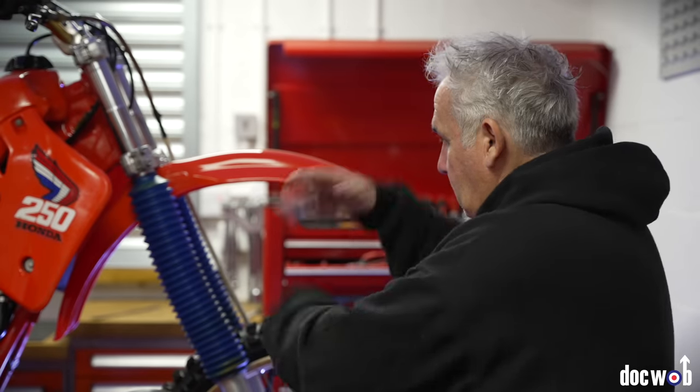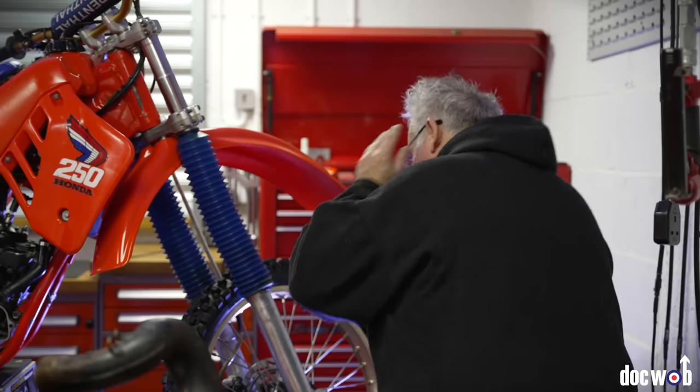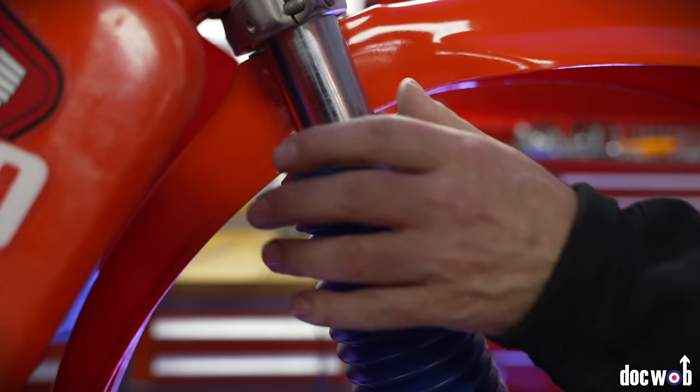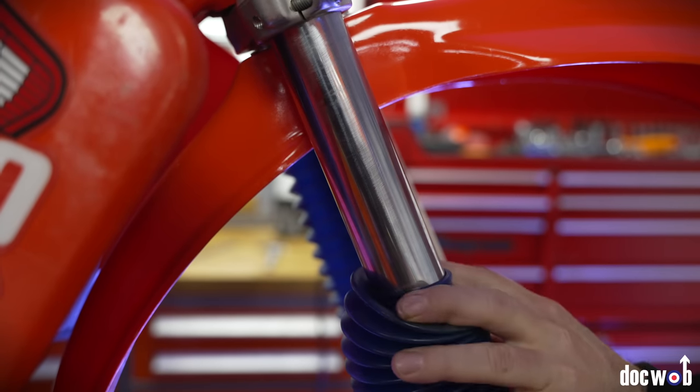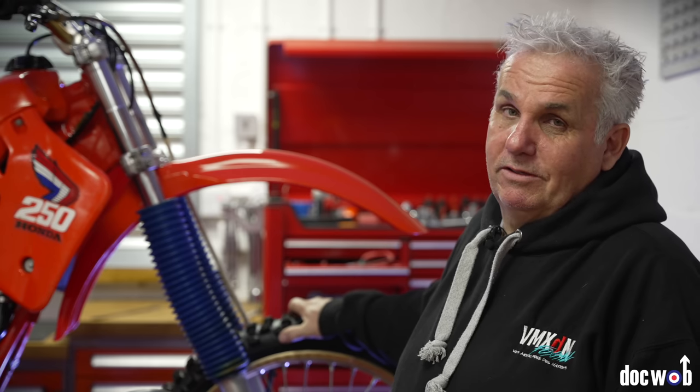For you youths who don't understand what these forks are — conventional 43mm. Really good fork, plenty of flex, they just match the bike really well. A lot of the faster guys back in the day used to run a WP front end, which stiffened it up a lot for the fast guys, but for your average Joe these forks are mint. They came on the 87, they improved them for the 88 and it wasn't much of an improvement. The 89 went upside down and they were awful — they did it because everybody wanted to look like the factory teams. But these are mint. A big worry on these bikes is you need to check underneath the gators, but these are absolutely brand new original Honda gators. And it's got an original made-in-Japan Bridgestone front tire — you can't buy made-in-Japan tires over here, so I think it's never been off the bike, which is incredible.